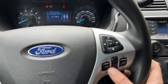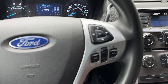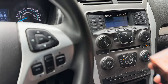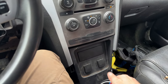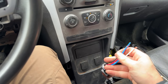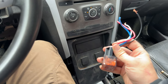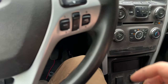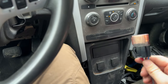These are just on/off switches. In order to utilize them, they're not that straightforward but also not that hard. What you need is some relays — just standard relays — because these switches are negatively switched. If you try to hook up the negative side of your LED light bars or chargers directly, you might blow something — in fact, you probably will. For each of the up to four switches, you're going to need one relay each.